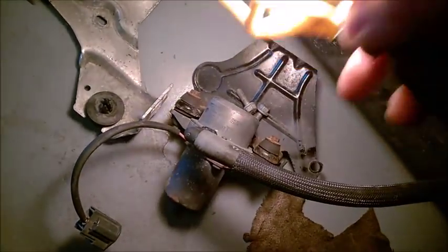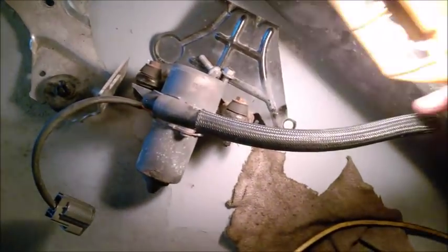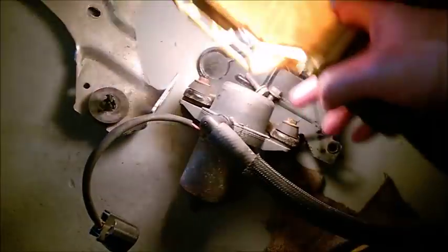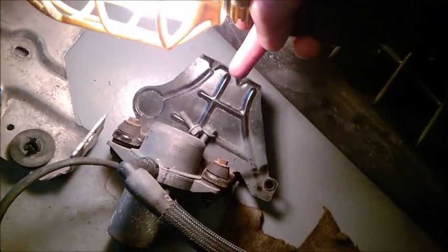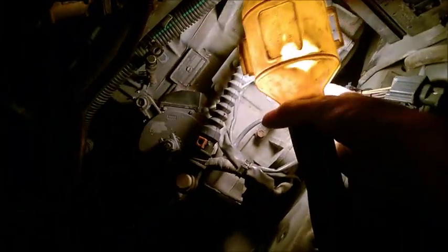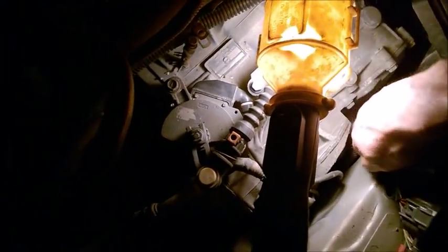You need to undo the pump if you have one. That's the priming pump for the brake booster. Undo the hose from the switch, if you have one, or from wherever it's connected, the connector. Do not touch these guys here. Just undo the bracket, it has two bolts, one at the top, one on the side, 10 millimeters. These connectors are locked on the larger bracket, and I think there's just a clip, you depress it and you lift it up. Just toss this away. The idea is really to toss everything away and make some place so you can work easily.